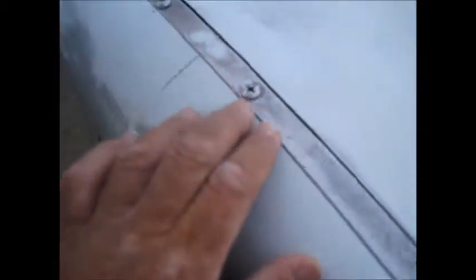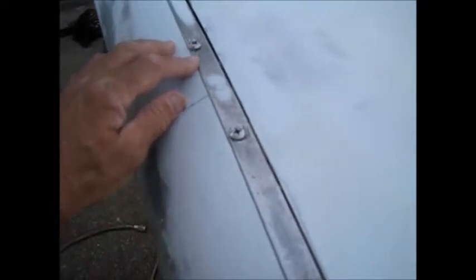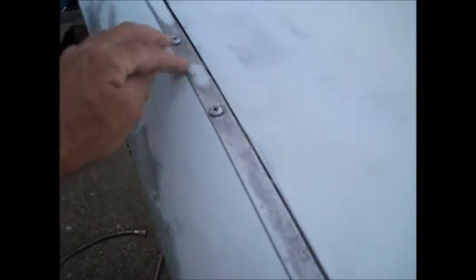None of these lines were ever neat. Like this piece here was lower than this one — it's just the way it was molded. Had to put a heavy metal fill up under here and on here, then put a little thin skim of Bondo up there.